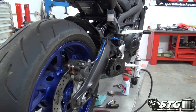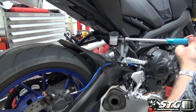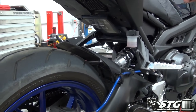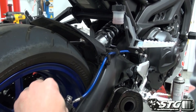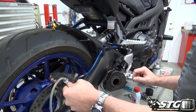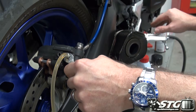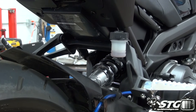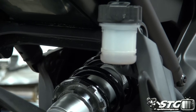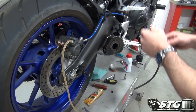Now we need to come up here to our rear brake reservoir and loosen the mount — this is the only way we're going to be able to get the actual cap off because they have a safety on the top. Go ahead and get back to our speed bleeder bag and hose, slide that over the bleeder, and we're going to exhaust almost everything we have in the rear reservoir. Open the screw, push down, close, let up — repeat that process until it's pretty much empty. Since this bike is relatively new and doesn't have very many miles on it, we'll be able to change the brake fluid with relative ease.